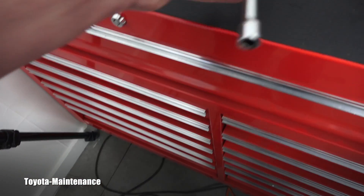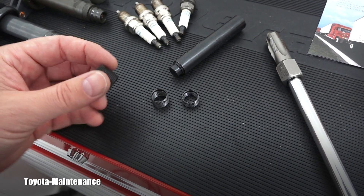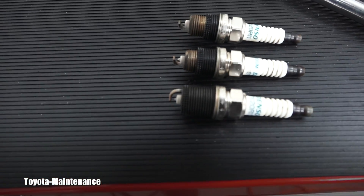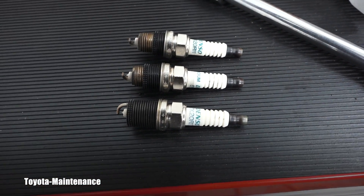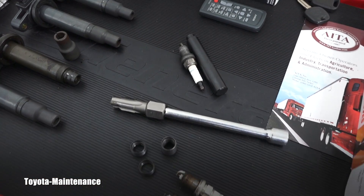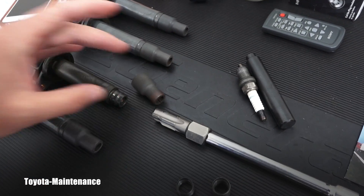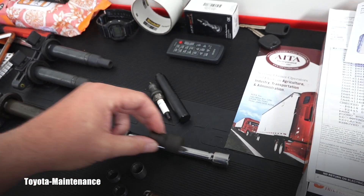At the end it's wiggling a little bit and won't stay very steady. Then you have to choose which one of those inserts you will use — most likely it will be the longest one, which covers that entire spark plug thread. I put all three inserts on so you can see how they fit on the spark plug. Of course this insert should not be protruding inside the combustion chamber. After enough research, to keep this extension nicely centered in that spark plug tube, I will borrow one of those broken boots.